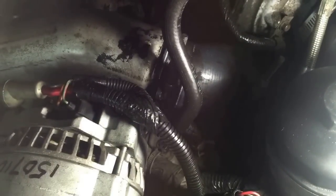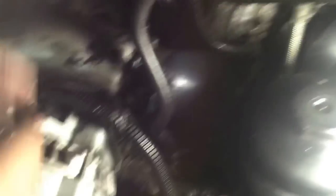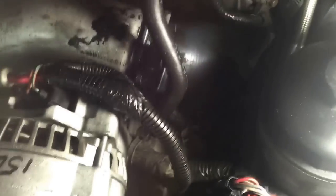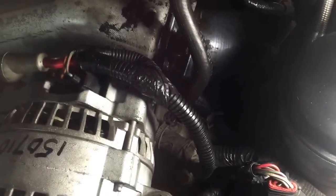With the heat cycles and the fact that this connection is meant to move — that's why they're spaced out — when the engine torques, the intercooler can't move, but these boots can. That allows it to give a little bit of breathing room to move.